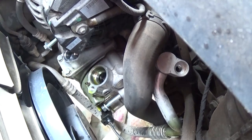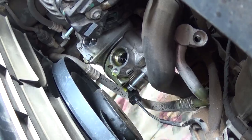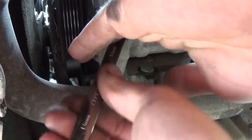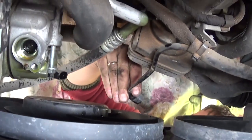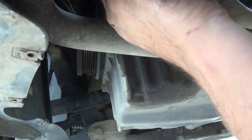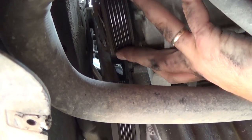We'll just drop it with the bolts inside of it — otherwise, you'll have a really hard time pulling them out and putting them back in. So for the new compressor, you'll need to install it with the bolts inside the compressor. Now we need to go on the bottom of the vehicle. There is one more bolt with that same 13mm wrench right there that we'll need to remove. Before you remove the bottom bolt all the way, you need to release the wire for the clutch, to engage the clutch. Now you can go ahead and remove the bolt all the way — but before you remove it all the way, you need to hold it with your hand because it will drop, and it's pretty heavy.